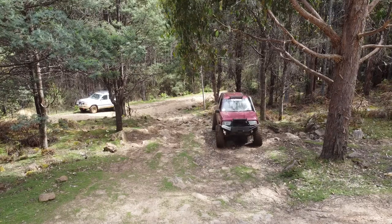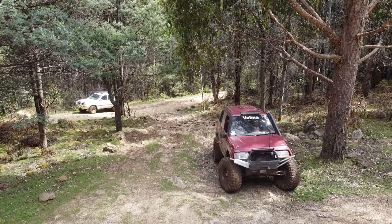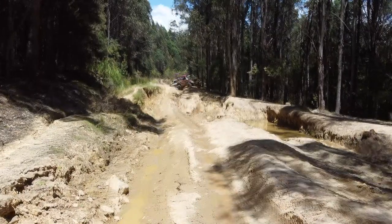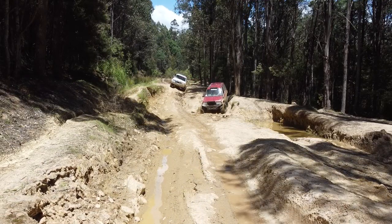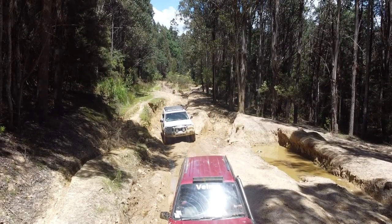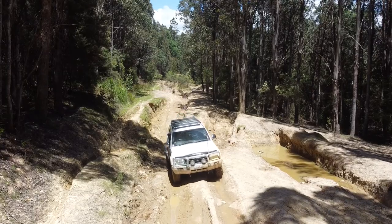Looking at, there's a few little driveline issues. It needs more gearing. That low is just not low enough. Oh god, does it need an exhaust? And I'd like to take probably 2 inches out of the ride height of it. It is just a bit too tall. It used to be a lot more stable, and it's quite a little bit floppy now. Like you see the switch at the start where it lifted wheels. It wouldn't have done that before on tour. So, actually, here's a couple shots of it on tour even.